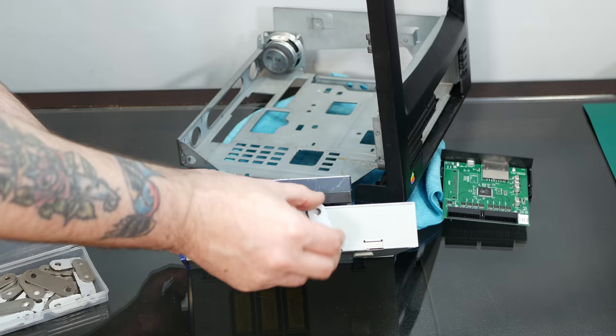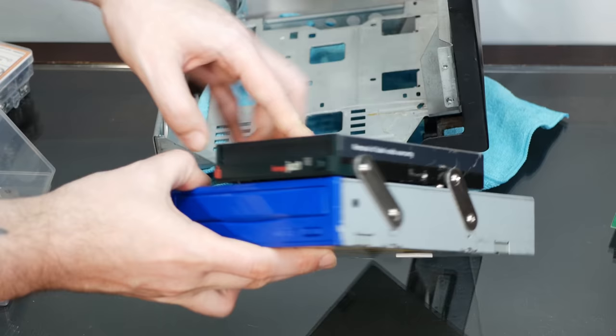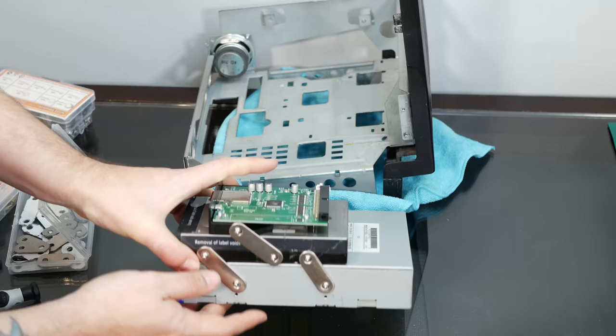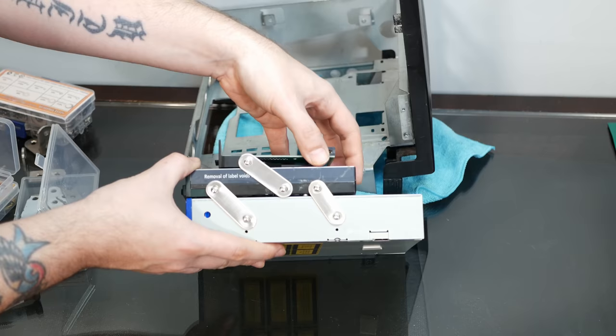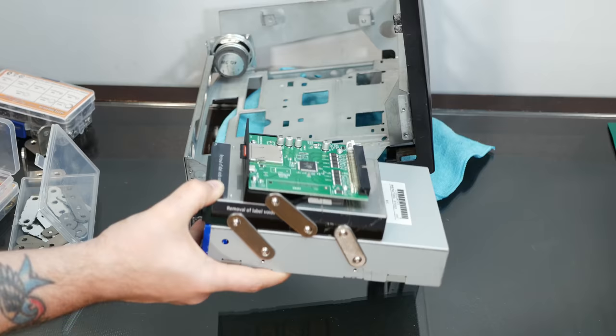All right, there we go. A homemade minimalist drive caddy made of just these two nice shiny bits of metal. And yeah, this drive is not going anywhere, so I'm pretty happy with that. And then I can add this other one here to hold the SCSI to SD in place, and yeah, it's almost like it's from the factory. And hopefully that's still enough room for the CRT to get past this hump here. If not, I'll just have to move it and maybe remove the bracket entirely and just stick the PCB down directly. But yeah, much better than the double-sided tape solution.